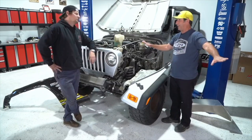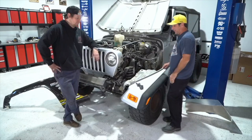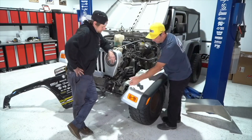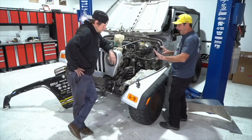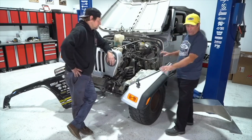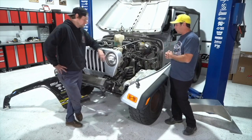If you have a popular color — red, blue, black, something mainstream — some guy with the same color Jeep can just bolt them on, and that's worth every penny. So keep that in mind. If you don't want to buy the optional inner fender, you need to cut along the factory fender, retaining the pinch seam. We give you a little template — you cut right around like this all the way back. The benefit is you just leave everything bolted on, get your saw out, cut the outer skin off, and slip on your new tube fender.